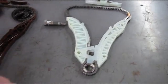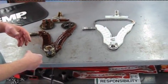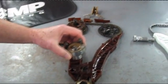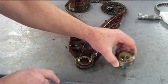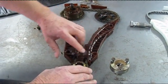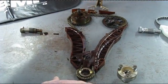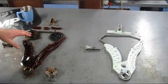This is an interesting way to change this assembly. Typically you would have to take the front timing cover off the vehicle. What MINI has done is pretty clever — the front crank hub comes out of the sprocket, which means the crankshaft is actually another half inch down in there. The front hub slides off once you remove the bolt, and then this entire cassette or module slips out because now the crankshaft is loose. Once we've removed the tensioner, we can slide that entire module right out of the top of the cylinder head.